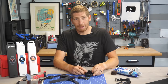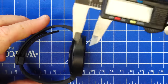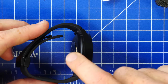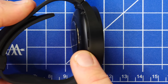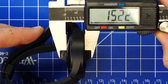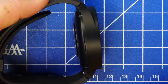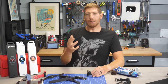I went to try to figure out what exactly Samsung is measuring. Here is roughly 10.5 millimeters on the calipers, and if you align it you can see it's essentially measuring only the sidewall of the watch — not the entire back portion of the case, not the sensor bump. The back of the case goes up about two to three millimeters, and then from there you get the sensor bump above that, another one-and-a-half to two millimeters, bringing it to the lower 15 millimeters versus the 10.5 they've claimed. So Samsung is excluding a third of the watch itself — the entire back portion of the case where the battery and other components are pushing that case out.